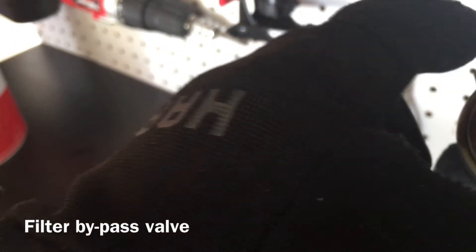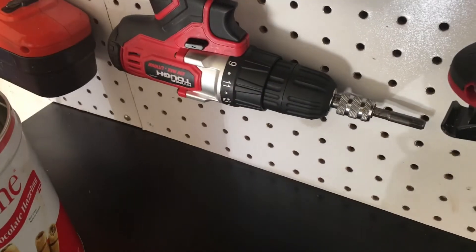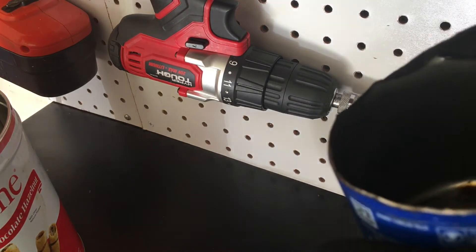This is a smaller filter. The pressed metal will be sharp, again why I'm wearing gloves. I like the steel end caps on this one — the filter media seems very neatly put in. Looking at the core inside, it's a nylon core, which probably flows better than the steel core on the FRAM, since the FRAM has smaller holes on its casing metal.